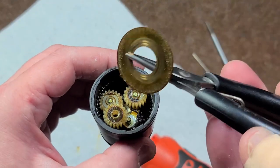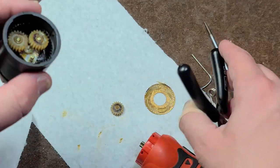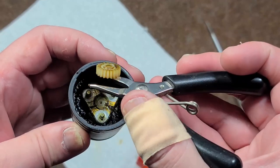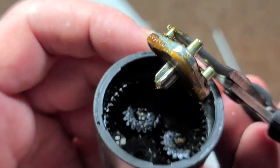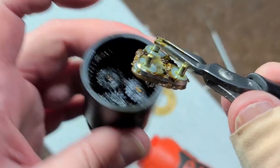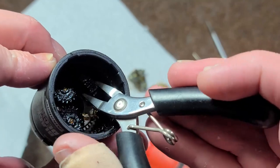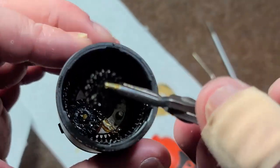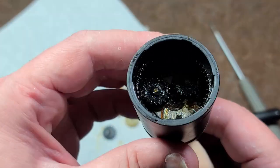Let's take a look at the gears. Kind of an interesting gold color for that washer. We indeed have plastic primary stage gears. We do have a planetary — that carriage is cheap. You can see that thin line and that eyeball metal — it's a cast zinc carriage with steel pins pressed into it, so that's pretty cheap. We have black gears on the lower stage. I suspect these are a harder plastic. Both stages are plastic just because this unit has a very limited amount of torque it can deliver. The ring gear is just this plastic housing.